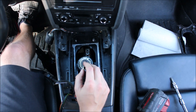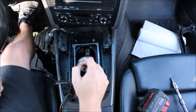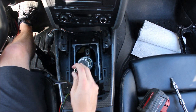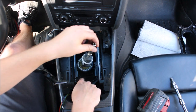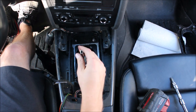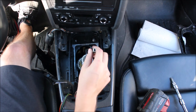This is where things get a little interesting — it's not hard once you understand how it works. Hopefully you're in neutral right now. While you still have this bottom bolt loose, you're free to slide wherever you want on that linkage. You should feel there's basically a square you can trace — that is exactly the extents of the base. Your shift lever is pivoting back and forth, and at the bottom as you go left it's hitting the wall of the shifter base on the right, and vice versa.